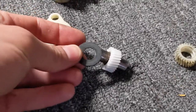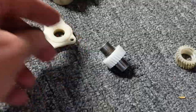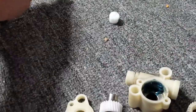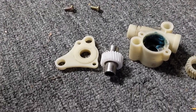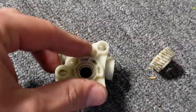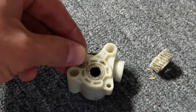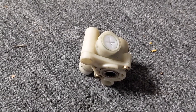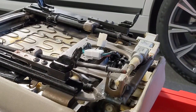Before you put this washer back on, grease both sides of it lightly. Then grease the shaft and everything and get this put back into the housing. Get the two Phillips screws along with the cap put back on — it's going to be a nice, clean, fresh new assembly, good as new. Gear and the shaft are back in, screws are back on. Now we're going to do the end cap. And voilà — that side is ready to go. Now we're going to do the other side, then get everything put back together and we should have a working power seat.